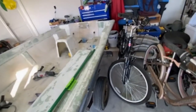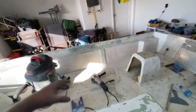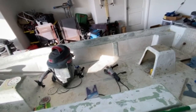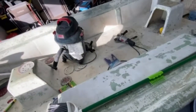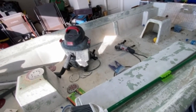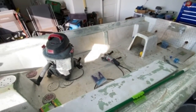I still need to sand the rest of the floor. They had something fiberglassed in the back — I'll smooth that out. A lot more work than originally planned. They did a really crappy non-skid: looks like they took play sand, put it in white paint, and painted the bottom with it. It's absolute junk — it just eats up my sandpaper. So I'm getting everything else done first, then I'll focus on the floor, flip it, do the very bottom, and then start wiping it down and get a coat of paint on.